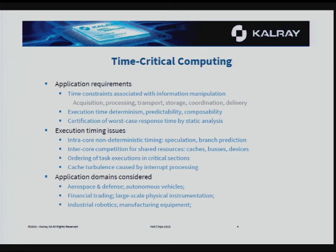And now, when you go to multi-core, you start to have a second problem. The different cores will interact and they will compete upon shared resources. Those resources can be hardware resources, and you also have software effects like amplification of timing differences from the order of taking locks, or for instance, exception processing, and you'll have turbulence in cache that will just disrupt your computation of response time.